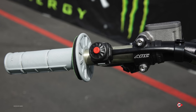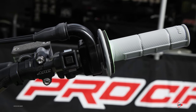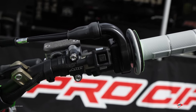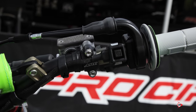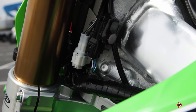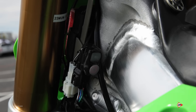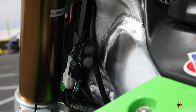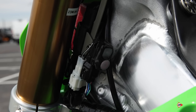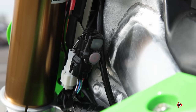Stock kill switch, kind of try to keep it out of the way. The start button has a guard on it, so if you ever lean forward or accidentally touch it, you can't bump it wrong. We do some work on it for protection and preventative measures — got some sheathing on it. We consolidate our start map connection to declutter the handlebar area, try to keep it free of too many buttons. It's tucked in, it's protected, and we put some epoxy on it to protect it from water getting in.